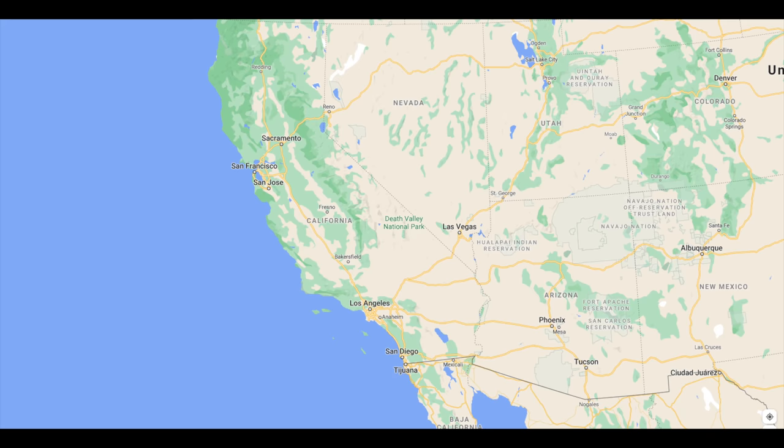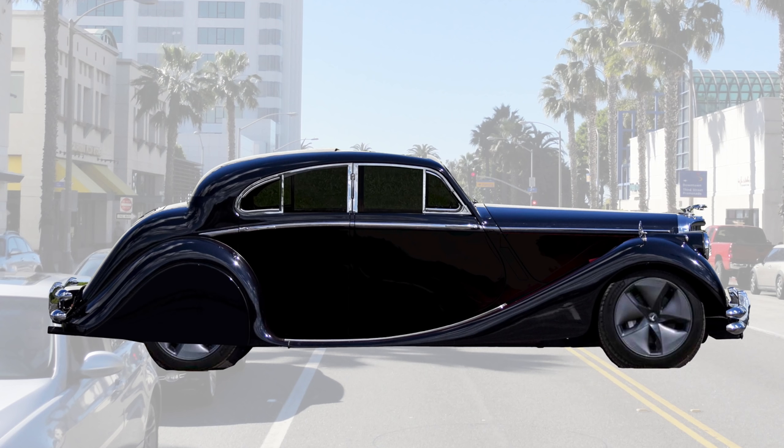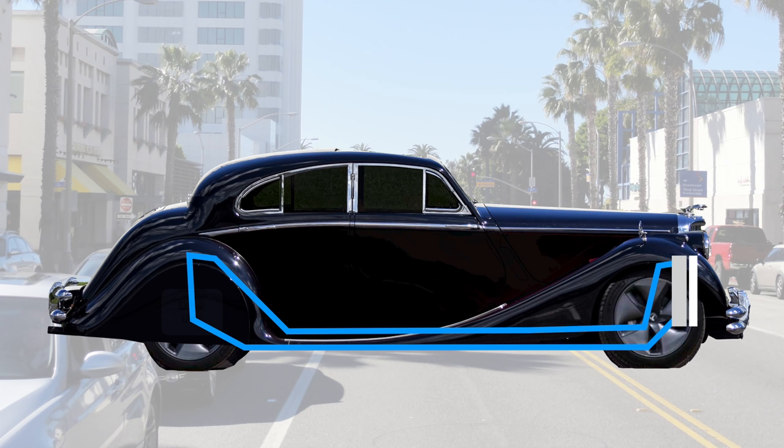For this video I'm going to get help from my metric friend SuperBritishMatt. You can tell he's a Brit because of the racing green helmet, and because he has a monocle for some reason. In any case, I drive in an environment that will allow the powertrain to run with just a radiator most of the time. I'm going to add active cooling with the chiller later. I'm also going to run everything in one big loop instead of having three separate cooling loops like Tesla does. Tesla has separate loops for the battery, the penthouse, and the drive units — their complex cooling system sends the correct temperature coolant where it needs to be. But I can get away with a simpler system.